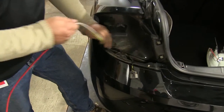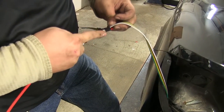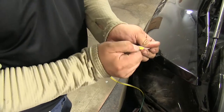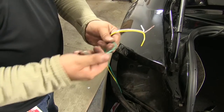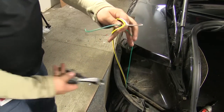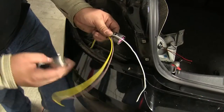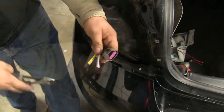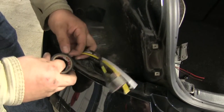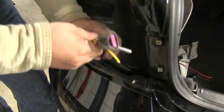Got all my slack pulled out of it, now I can take my electrical tape off. I've separated these out — there's just some glue holding them together. We're not going to use our green wire, so I pulled that all the way back until it meets the bumper and I'm just going to clip that off. I'm going to match it up to the length of our existing harness and clip the wires off, then throw some electrical tape to hold them together and keep our wires from falling down.